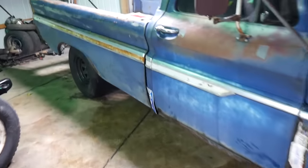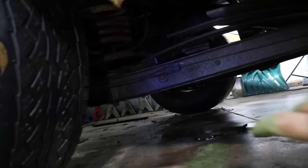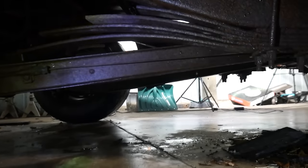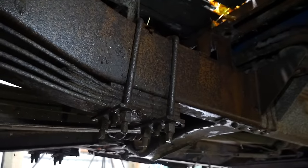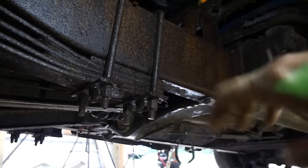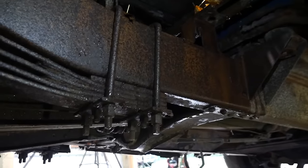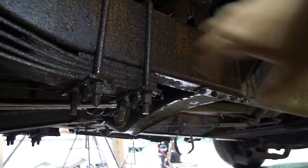The back end here, she's got overload springs on it, so I'm gonna have to take care of them first. And I've seen a couple different sets of these. I've seen them off the front here, and then I've seen them off the back as well. And I don't know if these are the factory ones or the other flavor is. If you know, comment below, because I'm really interested if this is some sort of aftermarket setup or an option or what. Since I've already got the fire wand out, I'm gonna just cut them, and then that'll come right out, and then a guy doesn't gotta fight them nuts off of there and all that other stuff. And I ain't gonna reuse them anyway.